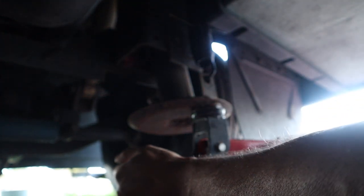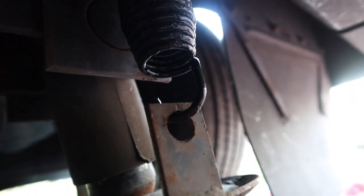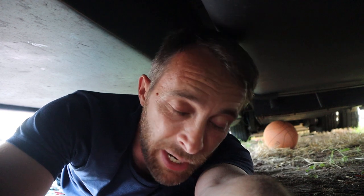I just realized I didn't get it on film, but I got it on — I guess that's all that matters. So one thing I did was: this bar or hook was up there at that top eye, and I just flipped it around and thought, well, I'm gonna see if it's any different or a little easier to get on — and it was. Ideally, you change all these out at the same time — I'm not going to. It's tough, it's hard to get them. So when you buy them, it comes in a package of two; HWH sold me two complete sets, so I have four springs. If another spring breaks, I'll use the extra spring I have. The other ones are still pretty stiff and difficult to take off, so I just don't want to mess with it, and it's difficult enough to get the new ones on. So I'm just going to keep the extra ones for when I need them.